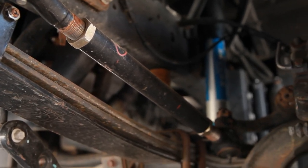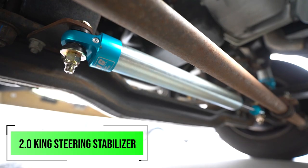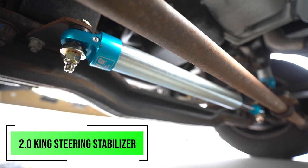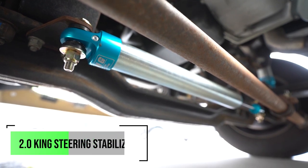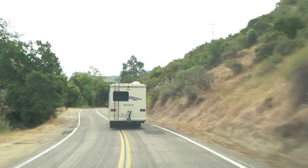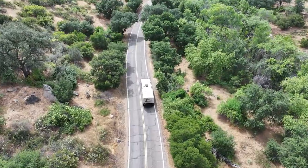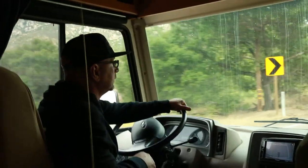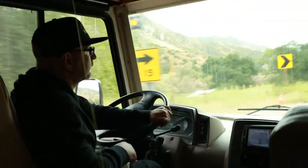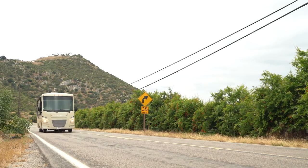The last product that we offer here at WeldTech Designs that we've done on this particular Winnebago Sunstar is going to be our King 2.0 steering stabilizer. We did go back to that smaller shock and it is a gas pressured shock — that's going to control your steering. Whether you're driving on the highway or down that windy road and you get that feedback in your steering wheel, it's really going to help reduce that feedback as well as tighten up the steering a bit to give it that nice controlled ride.